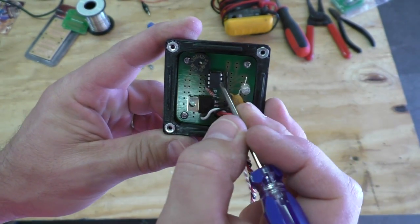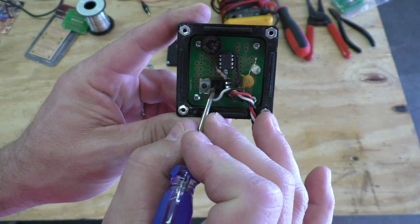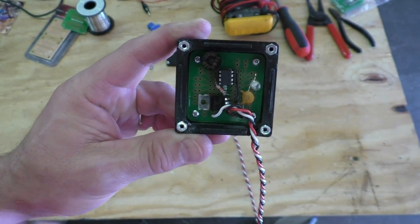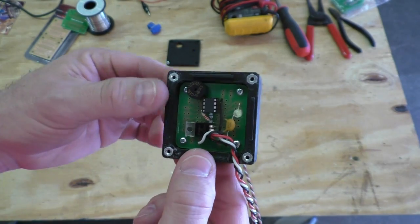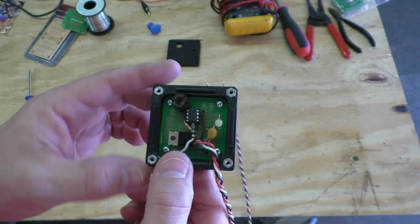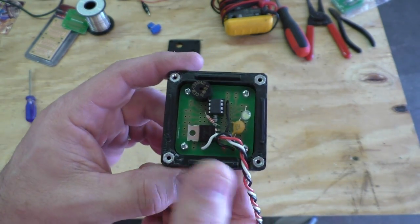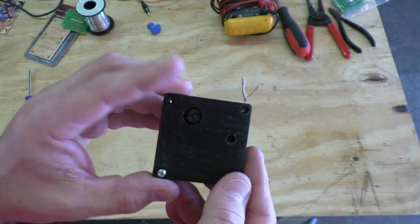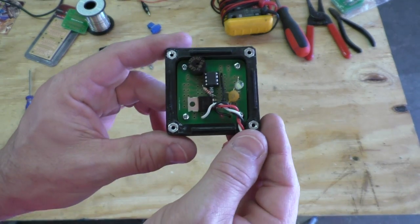Let me explain how this works. I've got an ATtiny, a pull-up resistor, a 7805 voltage regulator, a filter cap, an LED, and a siren — that's all there is to it. I'm going to put this together in this little 3D-printed case. I'll put all the files and source code for the ATtiny on the web page, so look for the link in the description. I've got a little lid that goes on here, so I'm gonna put this together and install it in the truck, then we'll test it out.